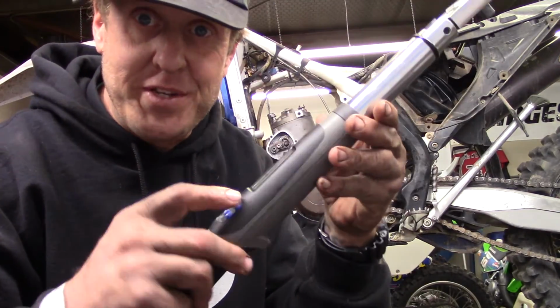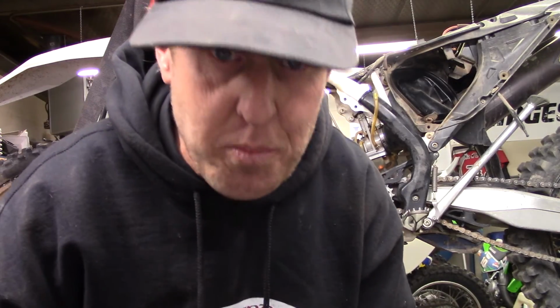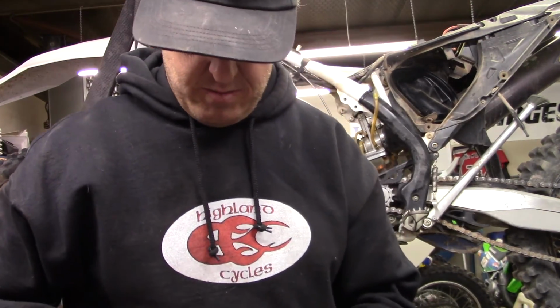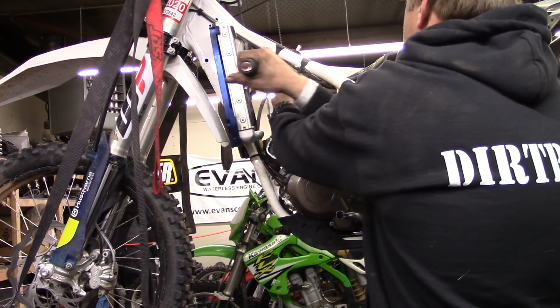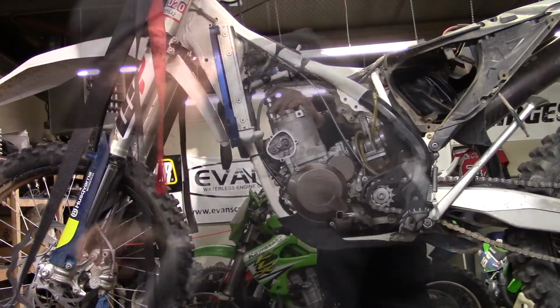I have a digital guy, so it's super easy for me, but let me find out what 27 Newton meters is for you. I'm sure someone's already beat me to this in the comments. So 19.9 foot-pounds, so 20 foot-pounds. So we'll set it at 20. You want to do them in a crisscross pattern, so we did this back one, we're going to go forward.